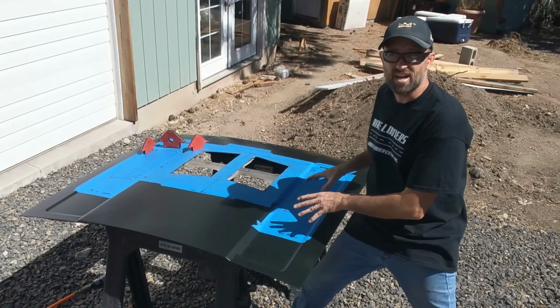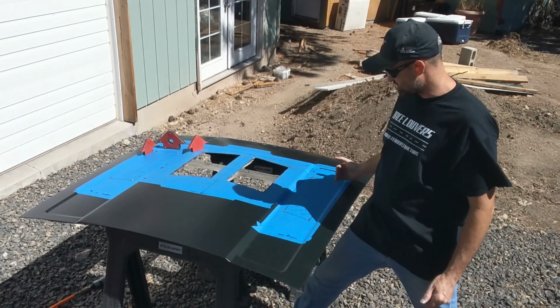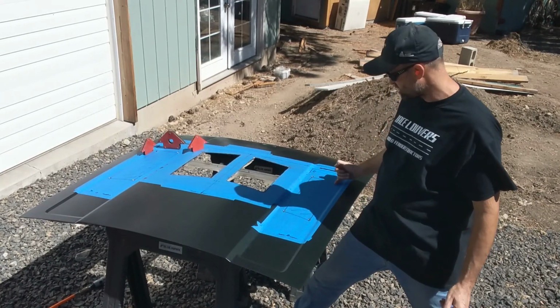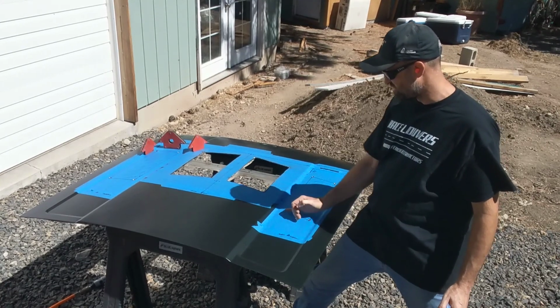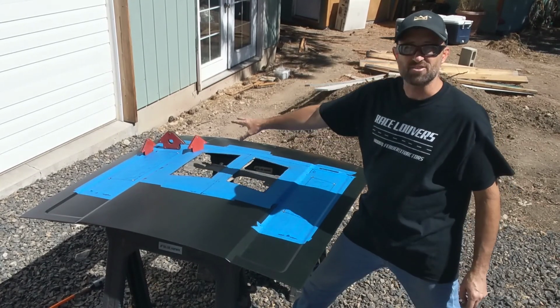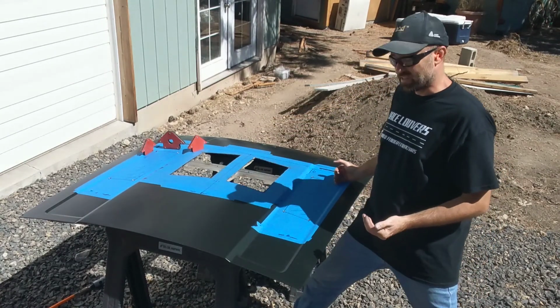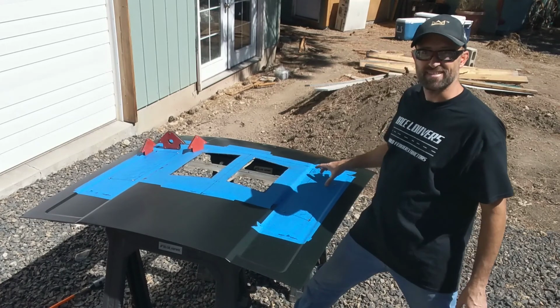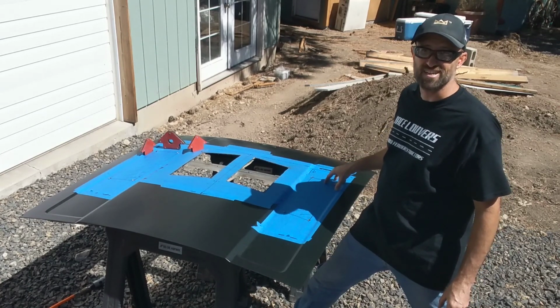All right, so it's finally time to start cutting on the side louver openings. With this, I'm just going to use a cutoff wheel between the holes and stay to the outside of the black line. Go zip this way, that way, and around. Now as you can see in the far corner, I have some welding magnets there. What I'm doing there is just cutting 2 edges and then placing a magnet over the corner, and that way it keeps this corner that's freshly cut stable.